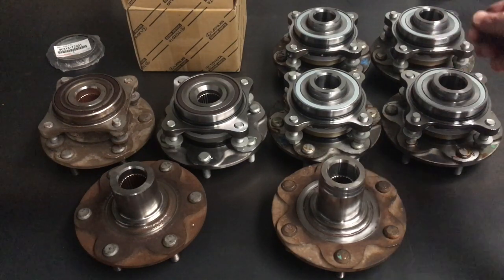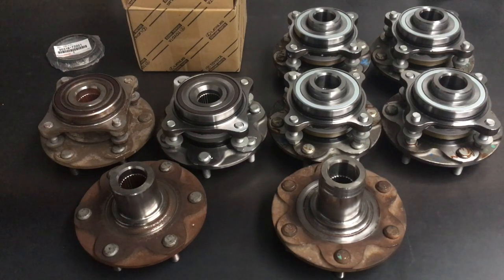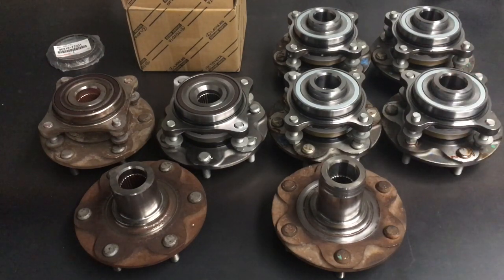The retainer can basically be gently set on and then gently tapped around with a hammer - it'll pop down and once it's on it'll be loose, so don't worry about that, that's standard. Once you torque up your wheel bearings to 235 Newton metres - check that, don't trust me on exact numbers - it's important that's done correctly. You can't just go close enough. It needs a torque wrench. That is the design preload for the bearing and that may be what correctly squashes the hub and bearing together.